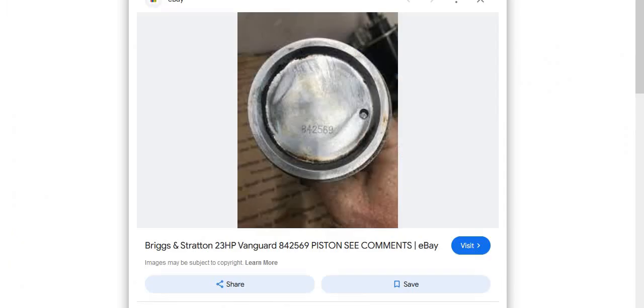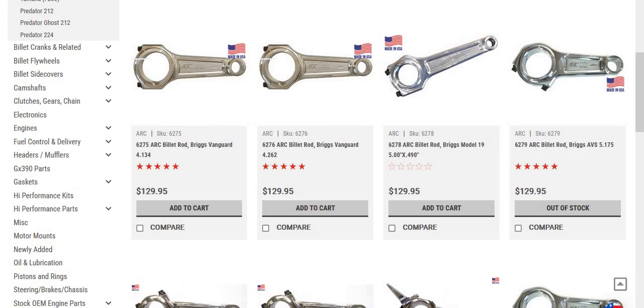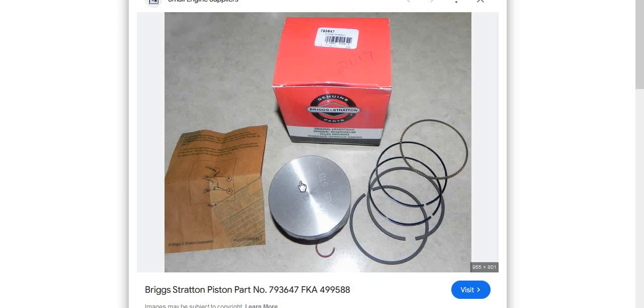I'm not going to get into the high-end gas porting yet. To review: you've got your stock stuff, this rod has got to go, and you'll notice it's cranked over on the bottom — I think for clearance while rotating, not strength. You'll replace it with one of the two ARC rods. If you're going to keep it low compression, you'll do the short rod. If you're going to cut the top off and try to go high compression, you'll use the long rod. Or just get the N-Tech flat top piston — you have to use the short rod with that.